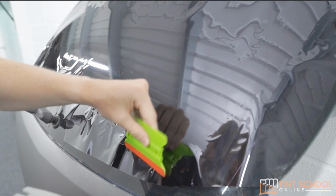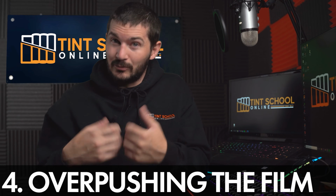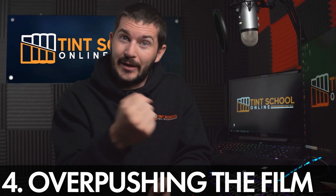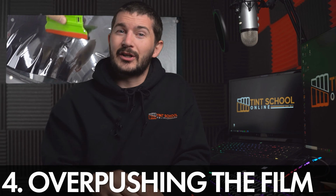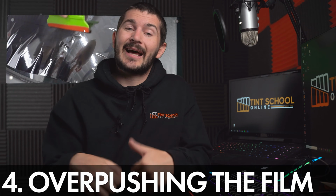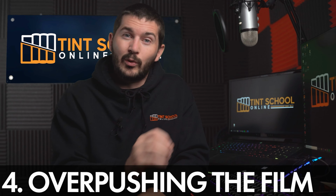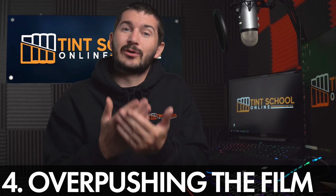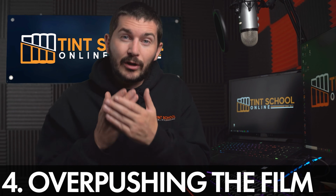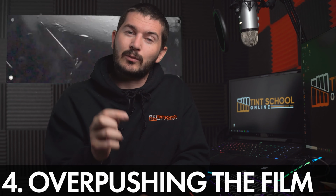It was exactly what I said he was doing wrong on the Astra. And out of all the mistakes I see, again, this is by far the most common mistake. So what basically happens is, in autopilot, you shrink the top of the finger and then you push way too far. You push what isn't shrunk and you're going to end up getting the steamroller crease, which is where you try to force the film down when it's not shrunk, thus causing it to fold on itself, where you get, again, the steamroller crease. Now, what this will look like is it will be a thick, sharp crease that you can almost pick with your fingernail.